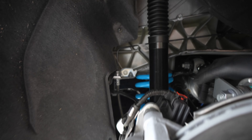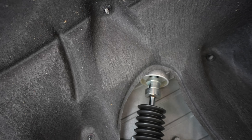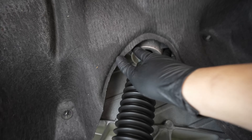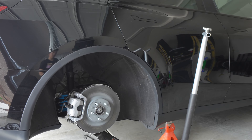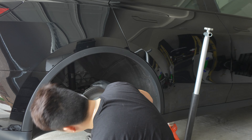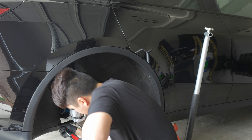The unit is installed. The top nut needs to be at 15 foot-pounds. The two bolts on the side are 40 foot-pounds. Then you want to jack up the assembly and torque the lower bolts to 85 foot-pounds.